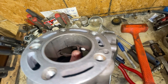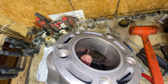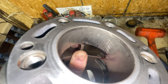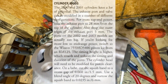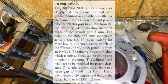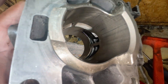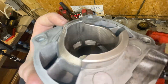His book says there's a lot you can do to these cylinders. This is allegedly a decent cylinder for doing some work on. It mentions lowering the outer portion of the exhaust five millimeters, which gets a little close to those transfer ports. We're going to work our way at them a little bit — just barely bring up that exhaust to 28 millimeter, widen the lower portion, and clean everything up. I have a new angle grinder coming in any day.